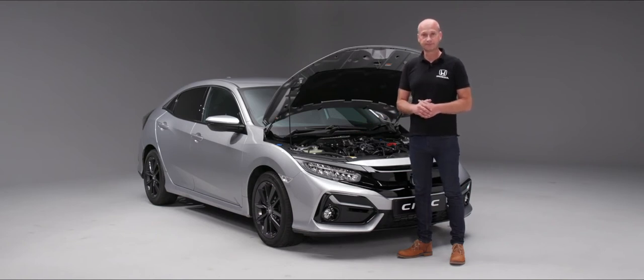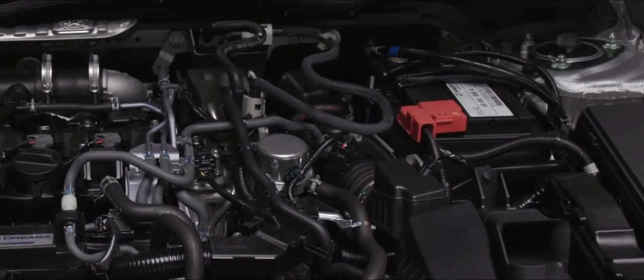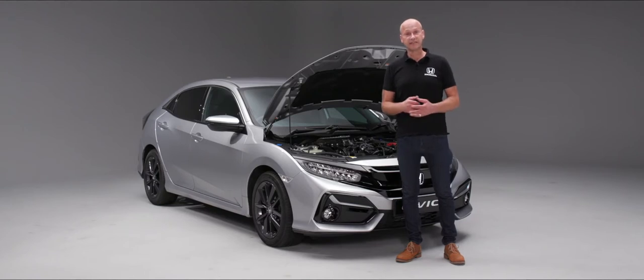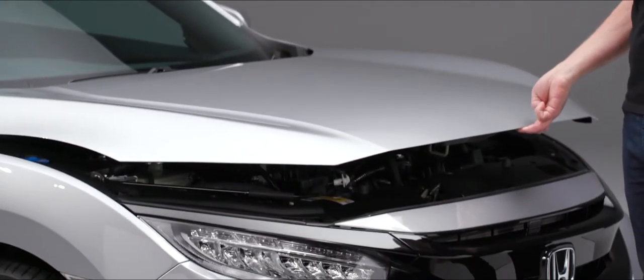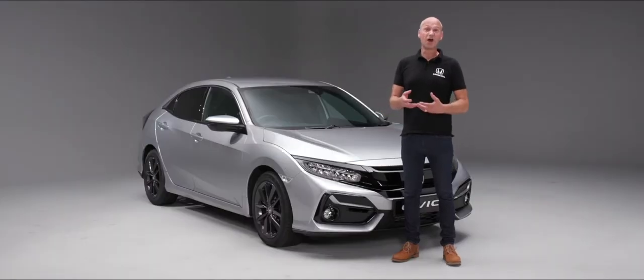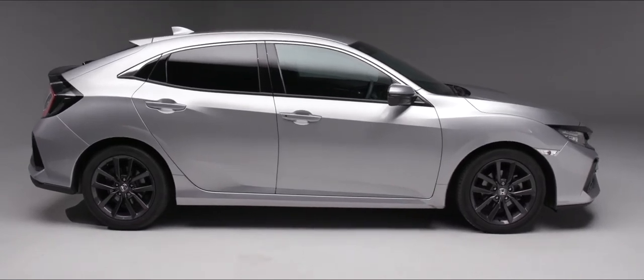Check the oil when the engine is warm and you're on a flat surface; check the coolant when the engine is cold. We also have a 12-volt battery on the right-hand side. Once you've checked and topped up the fluids, retract the bonnet stay, click it into place, and close the bonnet from a relatively shallow height — just let it close under its own weight. Your Civic's service schedule is 12 months or 12,500 miles; pop into your local Honda dealer for that service.